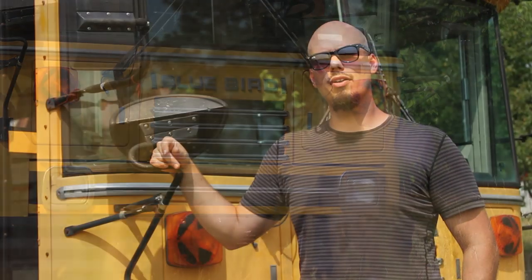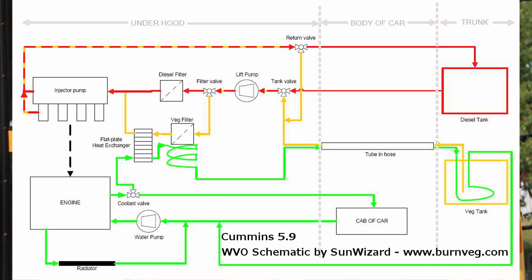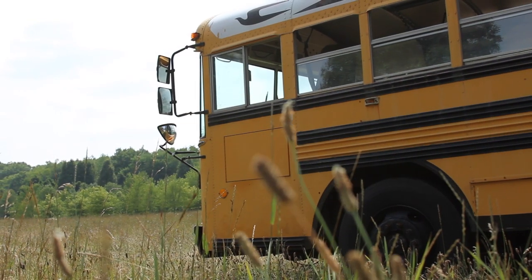We partnered up with WVO Designs for the major components for the vegetable oil conversion and also our filtering equipment. I found a design on the internet for a Dodge truck with the Cummins engine, which is the same engine that we have in our bus — a Cummins 5.9 — and I adapted that schematic to fit the needs of our bus. We have a two-tank system where the bus has the original diesel tank and then the entire vegetable oil system, and they're on switchable circuits. Many older diesel engines can run off of vegetable oil as a fuel as long as the oil has been filtered, dewatered, and the system has been heated. Heating the oil changes the viscosity so it's more like diesel fuel.